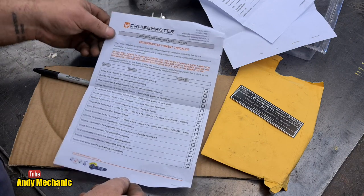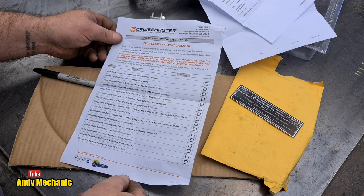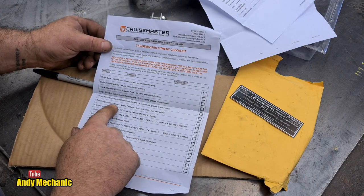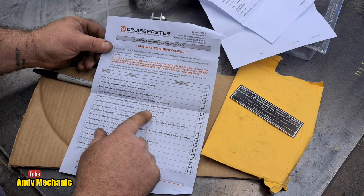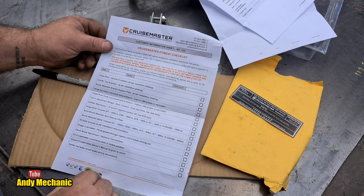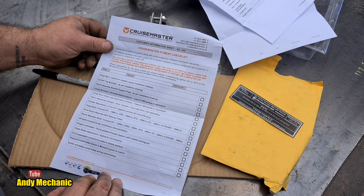Oh, customer check sheet. Okay. Hinges. Okay. Anything about there? Oh, look. See, toe-in adjustment. Remember, we were talking about toe-in in one of the previous videos. Toe-in is single, 2 millimeters. Tandem, front axle 2 mil, rear 0. Our trailer will be 0 toe-in. I don't want any toe-in whatsoever.